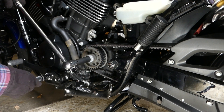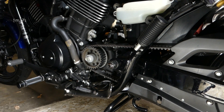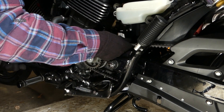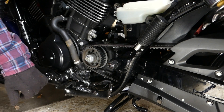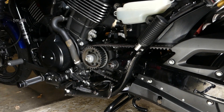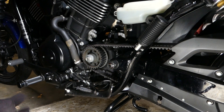I'm in a higher gear to see if I can pop this guy off — nope, I'm turning compression, so that means I've got to pull up another gear if I can move that wheel. I'm going to use a bar to break the tension and hold the wheel in place. Nothing like an inch steel bar.